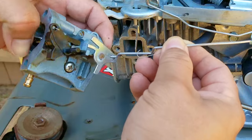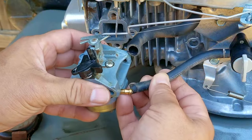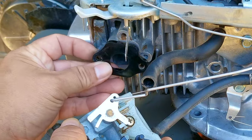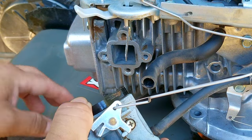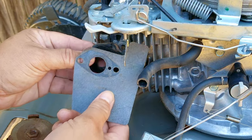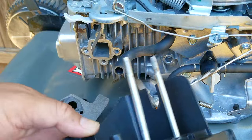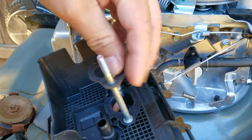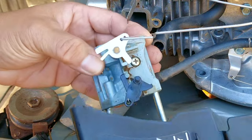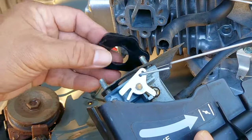So why do I think this engine didn't start? Considering all the facts we've seen, I'm guessing it's a combination of issues and not just one item. I'm going to guess that even though the fuel was not stale, it's probably not fresh enough to use either. Also, the choke system being based around a timer doesn't give you enough leeway to get it started in a timely manner. Now, those are the only items we checked — we didn't check on any part of the ignition system or even on the health of the engine, both of which could greatly affect if the engine even starts. If the engine is worn out due to poor oil maintenance, the chances of it starting and running is highly unlikely, and if it does start, it'll be down on power.